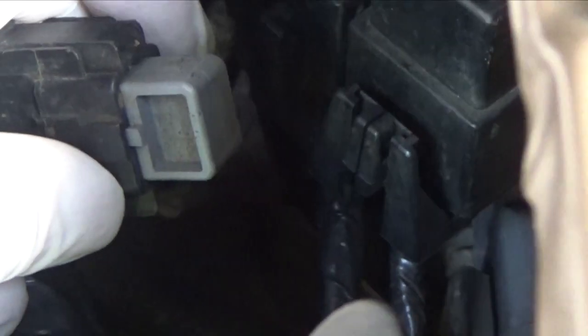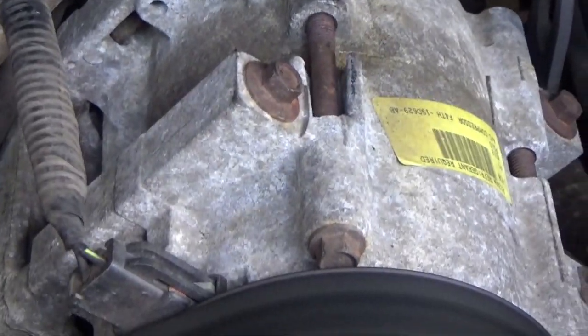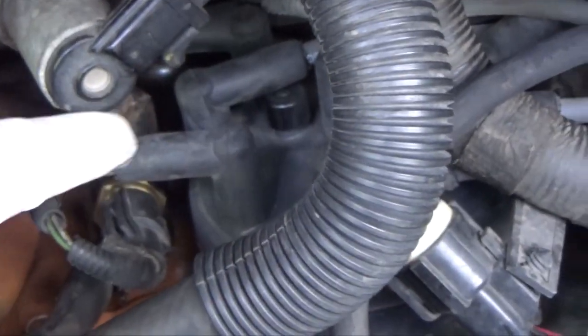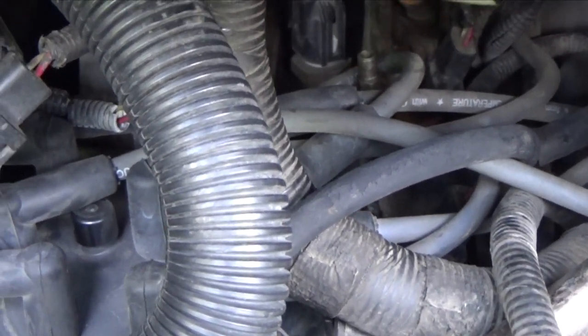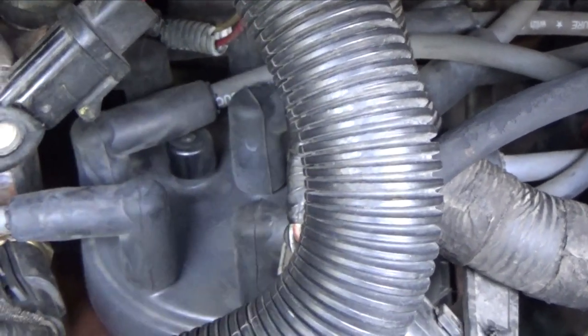So we're going to make some space here. That's the spout again. We're going to make some space here and wait until this meets the signal from the crank position sensor. The crank signal is coming from the distributor. This 94 doesn't have a crank position sensor, and the harmonic balancer is down on the engine. So it's inside the distributor. Okay?